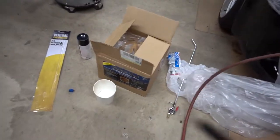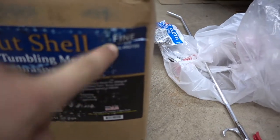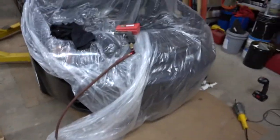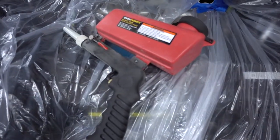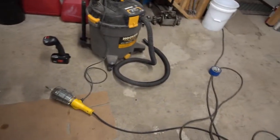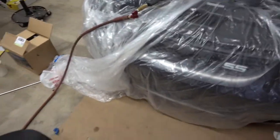So I'm back the next day. I made a Harbor Freight run to get the walnut shells — this is what you're supposed to use. It's the fine grade, I think it's 24 grit. I got a two-foot-long blow gun and the blast gun — this is the one I went with. I got everything taped off for the first cylinder. You can't see in there because it's really dark. I have a vacuum, headlamp, and another lamp just to be able to actually see inside what I'm doing.